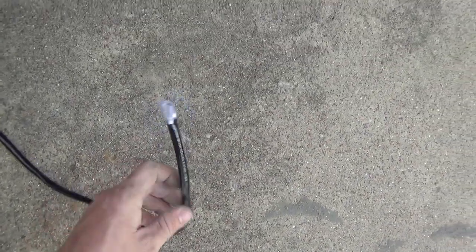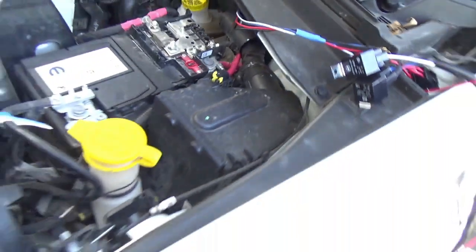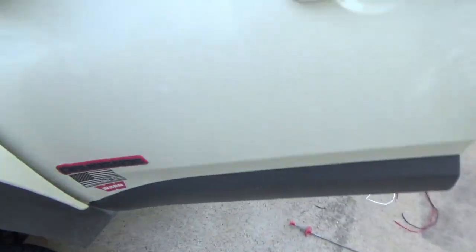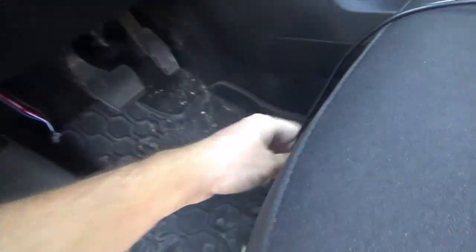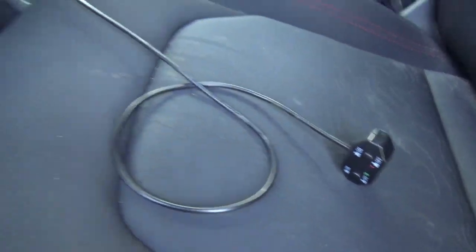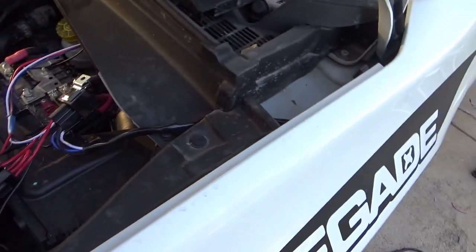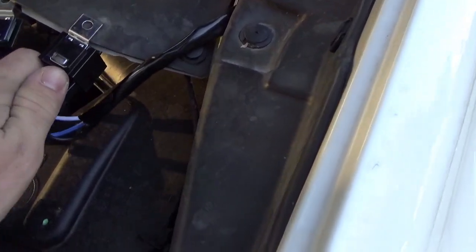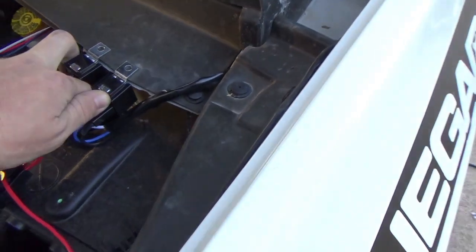It's a very nice wiring harness. I already got the connectors and bought some extras for my cables. I actually already pushed this through the grommet up on the floorboard down here, and that's what hooks up to the pressure switch to activate your actual light bar and your daylight runner lights. We're going to end up putting these relays right here — we're going to self-tap them into this metal sheet underneath for support, because there really is nowhere else to put them.